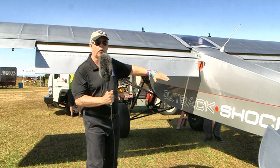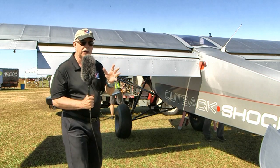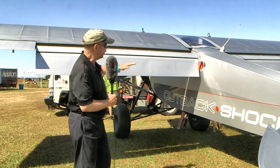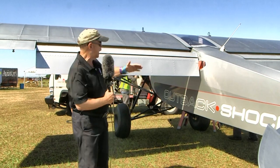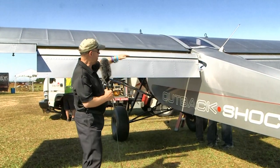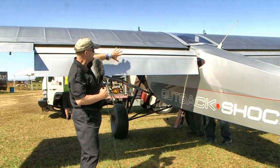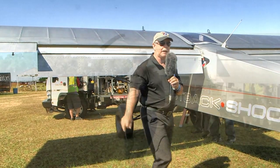These flaps come down 48 degrees, Bill indicated, and my word in flight was that these are barn door flaps, but a barn door flap is just a great big thing that comes down and it's solid and it's connected almost tightly to the wing. Barn door is the wrong word here because of all this air that comes through here and through here, but it gives the aircraft some amazing capability.